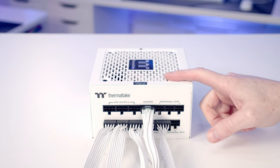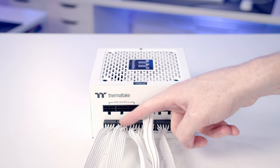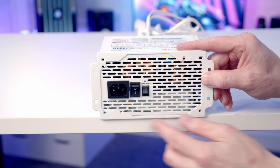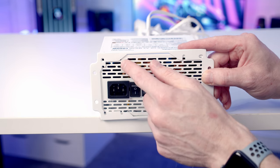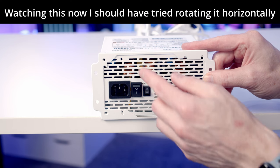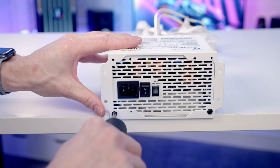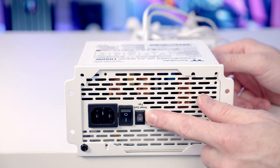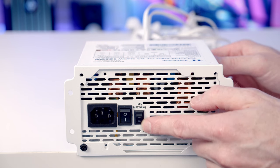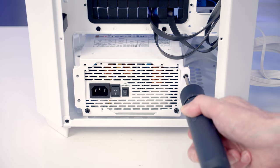Next we've got the power supply to install. I've pre-plugged in the cables we'll need: a 12V high-power cable for the graphics card, two 8-pin EPS cables for additional CPU power, and the 24-pin motherboard cable. When lining up the bracket you may only be able to secure two screws depending on orientation. The power supply has a smart zero fan mode so the fan stops spinning under low load to reduce noise — we'll turn that on. Slide the power supply into place at the bottom of the case with the fan facing down, then secure the bracket with the four screws.